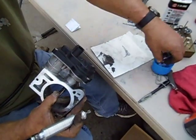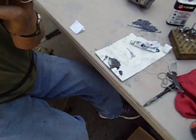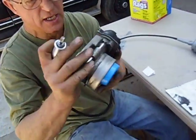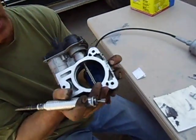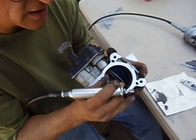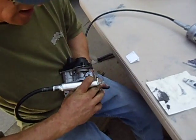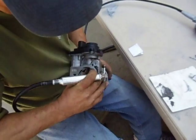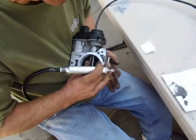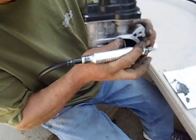One thing I like to do is take a cap, because it'll squeeze flat. Shove it in from the backside if you can — keep that throttle plate open and stable. You see, I'm just shoving it into the opening right there, and it'll hold. I just hold it with my hand like this so I can brace it and it stays open. I've got it stable. Because if you cut the bottom, then you're messing with the natural seat of the throttle plate, and it will screw with your airflow to a greater or lesser degree depending on how badly you screw it up. So here we go. You can use different lids if you feel more comfortable with it — some will work better than others.